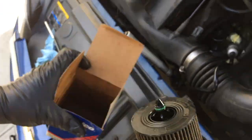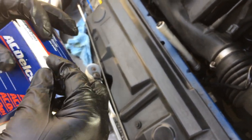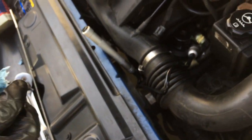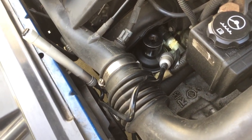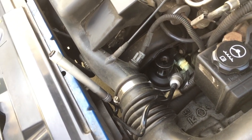The top is kind of getting stripped after many years, as they're plastic. So I replaced it and let it run for a couple hours today, and it hasn't leaked a bit. So that's another problem solved. I thought I would share that tip with you in case you run into a similar problem on these 2.2 liter Ecotec i4s. Thanks for watching.